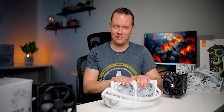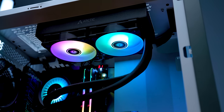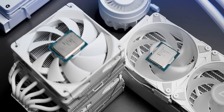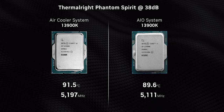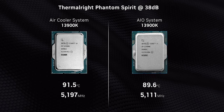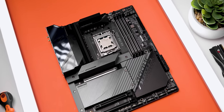So what are the competitors? The best on AMD platforms are not necessarily the best on Intel platforms. On the Intel side, we have the Corsair A115 and Noctua D15, along with the ultra well-priced Thermalright Phantom Spirit. Those are up against the Thermalright Frozen Edge as the budget pick, along with the Phanteks T30 and EK Nucleus. On AM5, there's the Noctua D15 with its offset kit installed, Thermalright's Peerless Assassin and Phantom Spirit, alongside the Arctic Liquid Freezer 3, Deepcool LT520, and Phanteks T30. With the tens of thousands of lines of data from previous videos, we should be able to put this together relatively simply — but it's not as simple as that, unfortunately. We actually use two separate systems, both with 13900Ks, and since even a slight sample-to-sample variance has pretty big impacts on our results, we're using the AIO test system to normalize everything out. As for AMD, we use the same CPUs for both air and all-in-one liquid cooler results, so those can be carried forward.